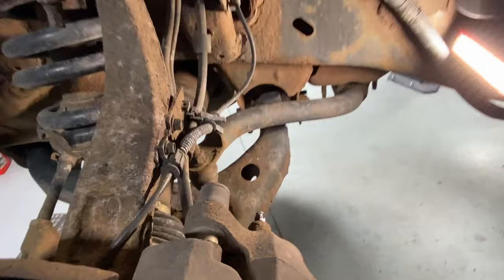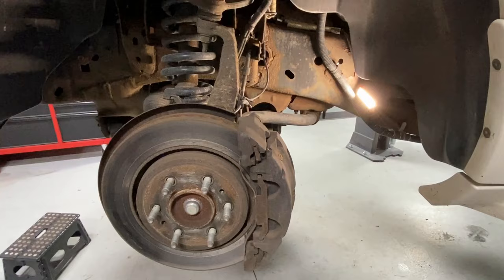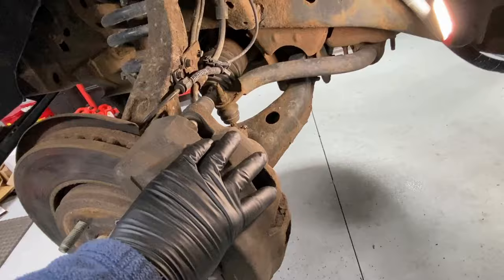What's happening is the brake hose right here has actually failed inside. It's a very small passage inside — it's a really thick-walled tube and the inside passage is actually really small. Once it deteriorates inside and a piece of rubber comes loose from deteriorating, it can't hold pressure properly. The fluid will come in and apply pressure when you hit the brakes, but it should be able to exit back up to the master cylinder.